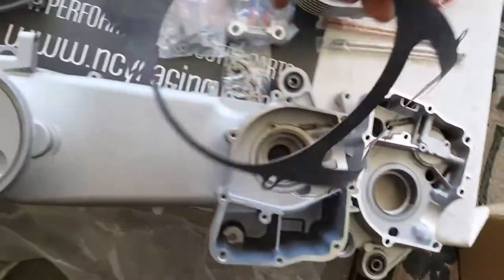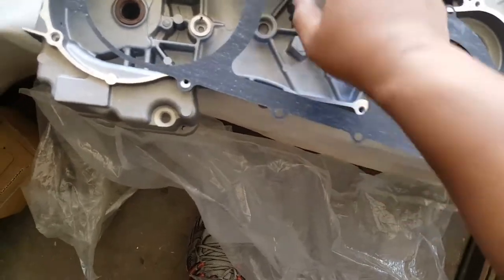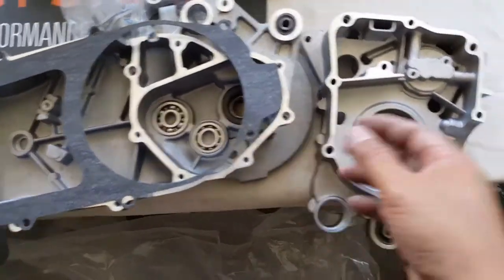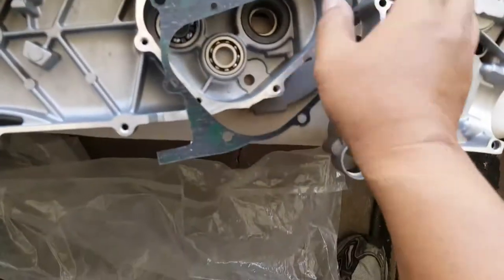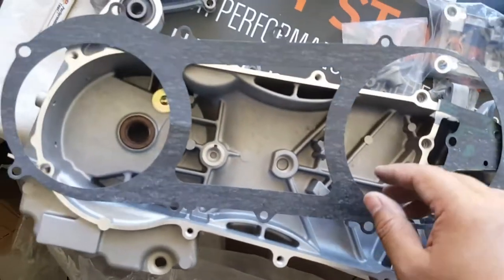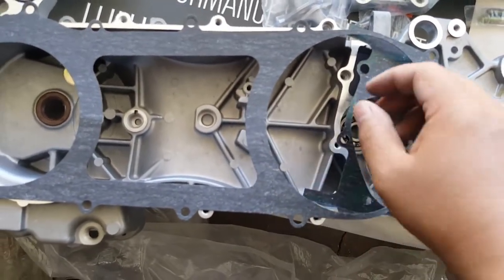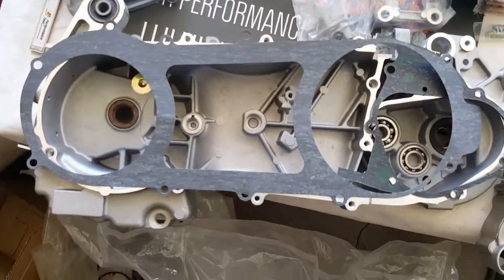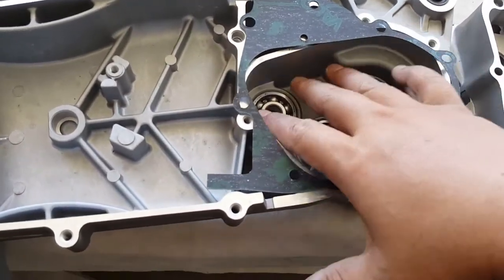Keep in mind they are going to give you gaskets for your CVT cover. Here's your CVT cover gasket. Underneath it, you're going to get a gasket for your transmission cover as well as for your stator area. The stator is right here, and the transmission goes right here — before your CVT cover. I don't recommend putting any gasket sealer on your CVT cover, especially since you may need to change out variator rollers or the CVT clutch and want easy access. It just protects from dust. Some people even leave it exposed, but I don't recommend that for safety. You do need a good sealant for your transmission specifically, for all the fluid.